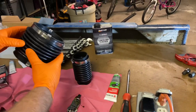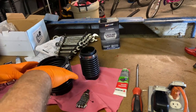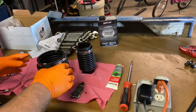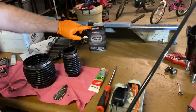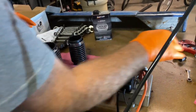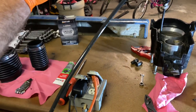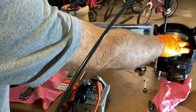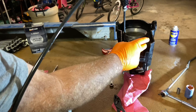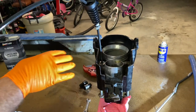These actually come with a white powder on them that's a poison — you're supposed to clean that off. I guess it prevents rats from eating it. Anyway, you're supposed to get that cleaned off so it'll stick. You take some lacquer thinner, put it on a paper towel, and clean the insides and outsides of the mating surfaces and let it dry. That includes the bellows and also where it's going to adhere to. I also took some cleaner and Scotch-Brite and cleaned off the old bellows adhesive off my gimbal so I could get a good seal.